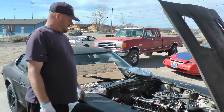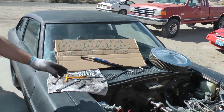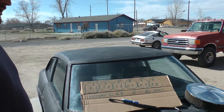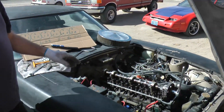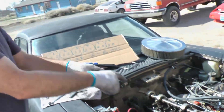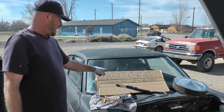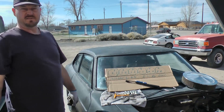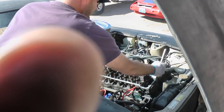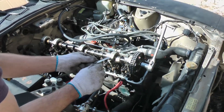While you're doing your valve adjustments, there are 12 valves — six intakes, six exhaust — on the L28 inline six. We've got it all organized because there are so many lobes. For example, one lobe and number six will be ready at the same time, so you'll be shuffling around doing different rocker arm adjustments. To keep track, as we do each intake or exhaust valve, we check them off on the checklist. The lobe pointed in the up position is when you can take your measurement.